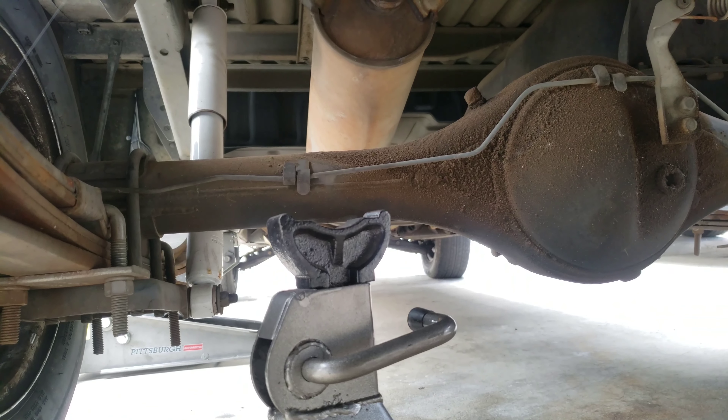So we drop it — see how that tire is just barely lifted off the ground. Stand is over there. Now once we remove that bolt, remember it's gonna come down a little bit, so you just don't want that surprise. Let's add that jack right under the diff. All right, that's right under the diff, nice and pressed on there. You don't want to lift it too much.